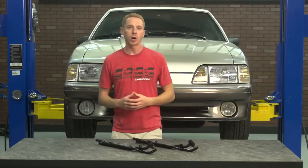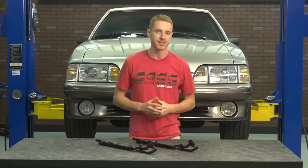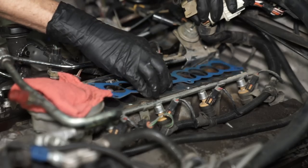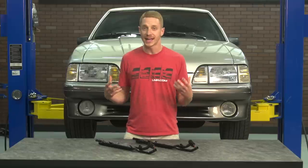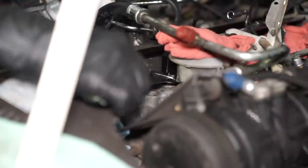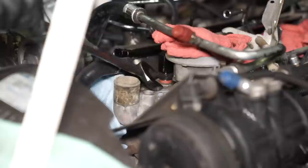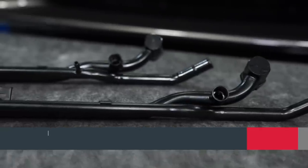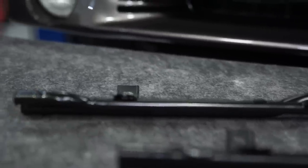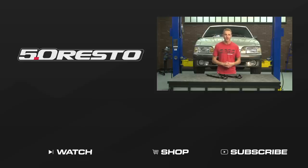Wrapping things up here guys, I would strongly recommend setting aside a few hours to get this one done. Be mindful of other components and replace them while you're there, such as the lower to upper intake manifold gasket and the rear PCV components, and of course anything else that may need to be replaced. Make sure that the swivel fitting at the front of the heater tube threads smoothly into the lower intake — double and triple check the threads before you start threading it into the intake. You're going to have premium materials here — it goes right into place and it is a must-have for your 5.0 or 5.8 liter Fox body. To see more how-to and review videos covering industry-leading products, be sure and subscribe to our YouTube channel, like this video, and don't forget to turn on notifications. Check out our other videos and don't forget to shop LMR.com for all things 1979 to present Mustang and SVT. Thank you.